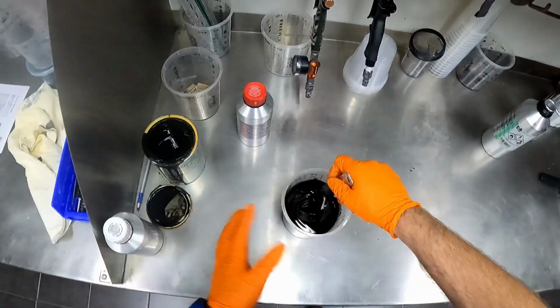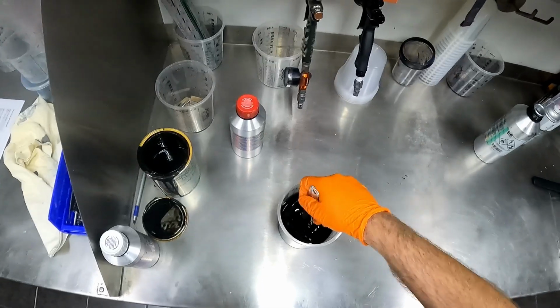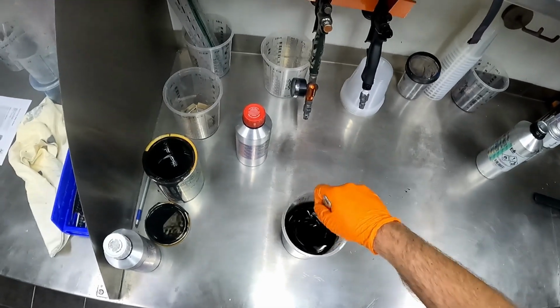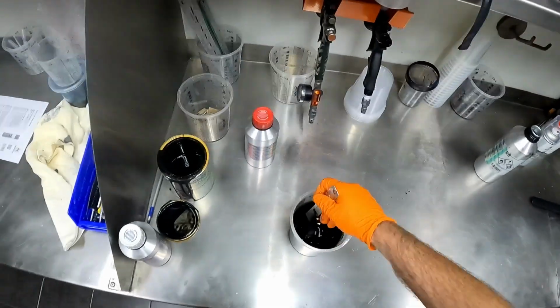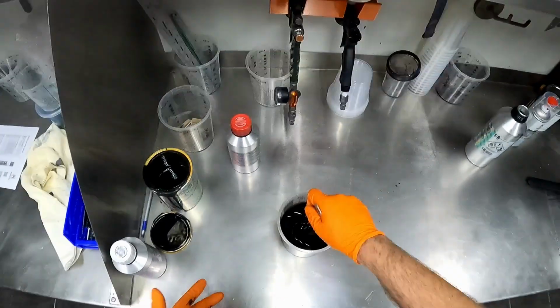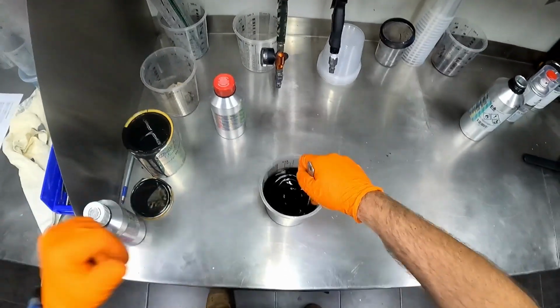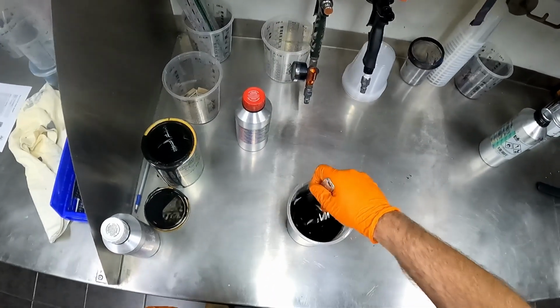We'll go through probably 3 to 4 coats over those guards. It won't need any more than that. It's not like I'm blocking it with like 120 big long panels and all that. It's pretty easy. Just a couple of coats is all it really needs to seal down that rust converter that we've got on it. And yeah, that's pretty much it.